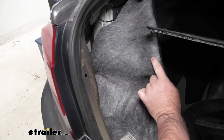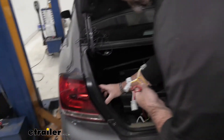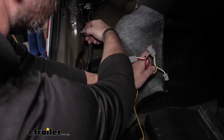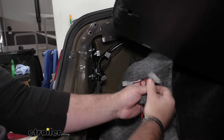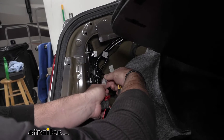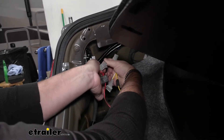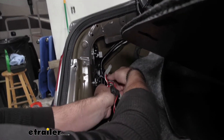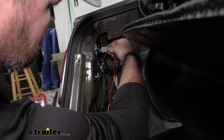We're going to do this on both sides. Take our wiring harness — yellow wire, brown and red. Over on our driver's side, we're going to disconnect this plug and this plug. Then we're going to match the plugs and take the other end and insert it back into the tail light.